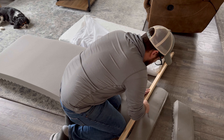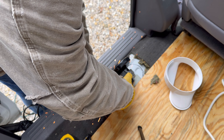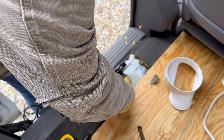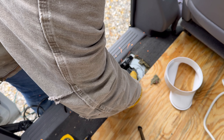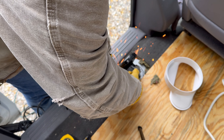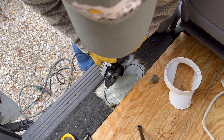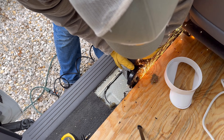Let's double-check underneath real quick. As long as we stay inside of this pinch weld right here it would be just fine. We might have to tuck a corner of it kind of underneath our board there. We're not going for perfection here, fellas. This is just kind of like a pinch weld hump thing. We'll press this into the floor, silicone the crap out of it, maybe shoot a couple of self-tappers into the sides — done. Let me go grab a Sharpie and mark this thing out.